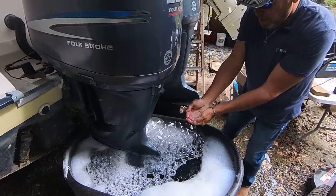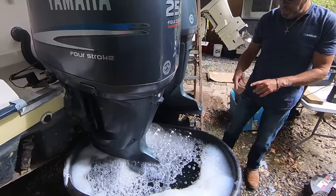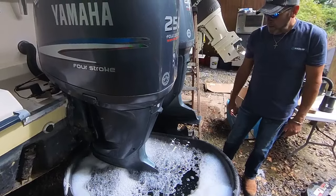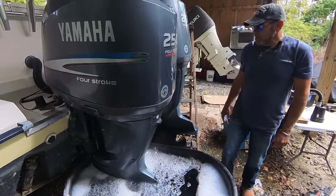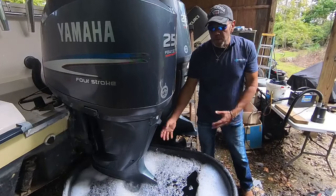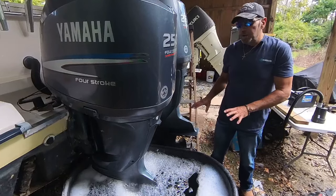See that — nothing but soap pouring through this outboard right now, along with water, vinegar, and our Ajax super degreaser. You can run this for a while — this water's about 60 degrees. You don't have to worry about the water getting hot for at least 15 or 20 minutes from the hub exhaust. You want to soak this as long as you can.